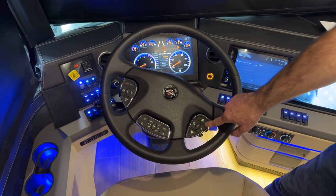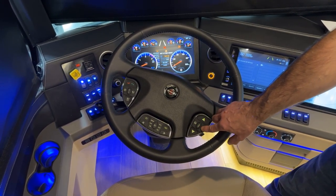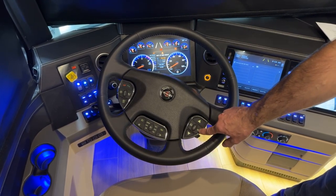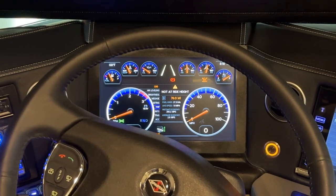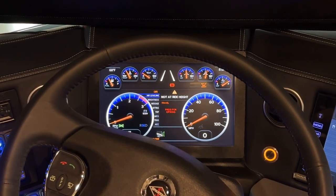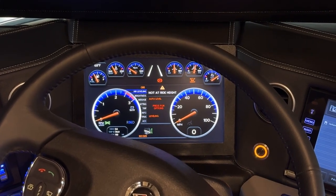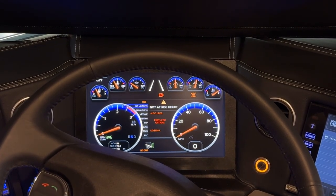The next button cluster is for the glass dash screen control. The home button takes you back to the home screen, the middle is the OK button, the side button is back, and you have up and down buttons. On the glass dash screen, hitting the up button and going to air leveling, then pressing OK, takes you to the air leveling functions. Selecting auto level and pressing OK will start to auto level the coach on air using the air suspension.